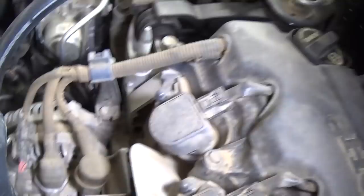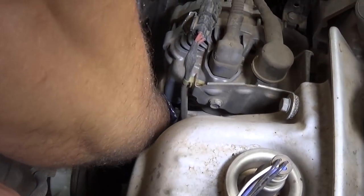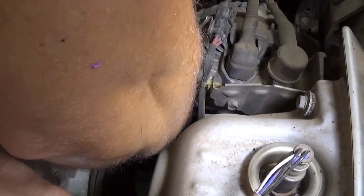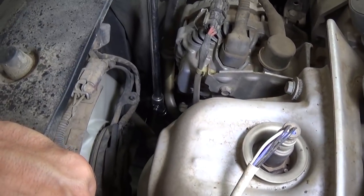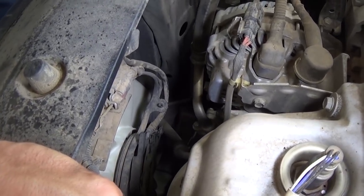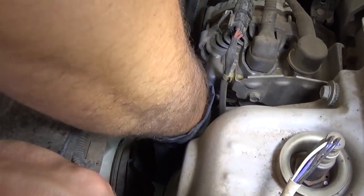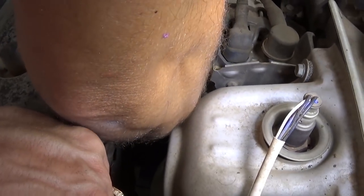That's what it looks like — just a regular nut. Now you need to make sure you don't have any pressure in the system. Make sure you don't have any refrigerant in there, otherwise when you remove the nut the hose is going to come off and you're spraying refrigerant — that can seriously hurt you. So make sure you don't have any pressure or refrigerant before you proceed, before you even start removing the belt.